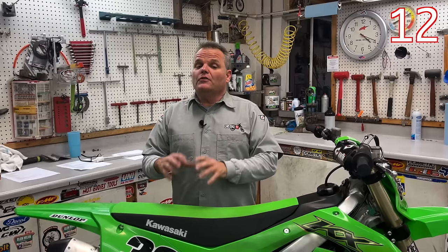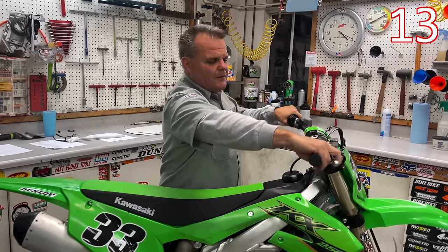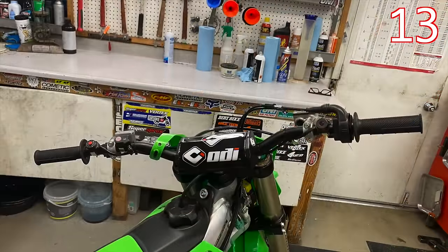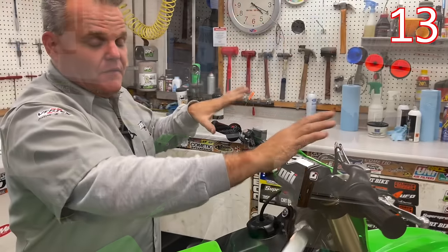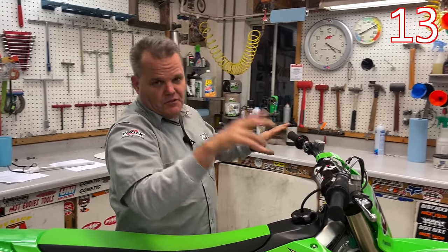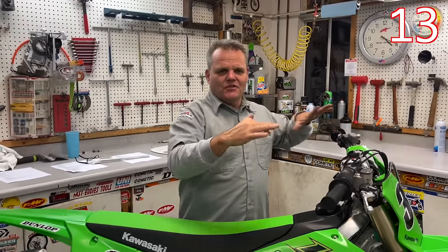The stock air filter oil might not be oiled enough, so I would check it before you ride and oil it a bit stronger with good oil so that it's really well oiled. I'd also make sure that all the levers are where I want them to be. Since I know I'm going to have the bike a long time, I would run the bars that I like — the ODI champ bar bends and lock-on grips — so it's comfortable from day one.